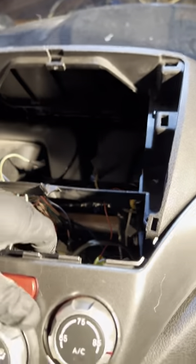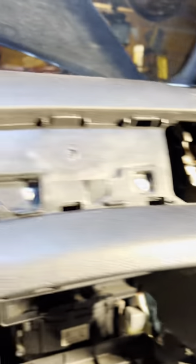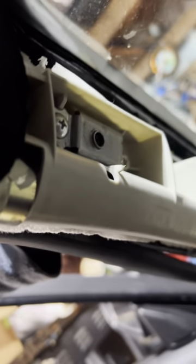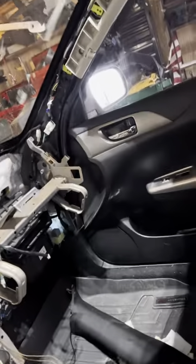When you remove the glove box, you're going to pop off all of this and there are going to be screws that go all the way along here, as well as two behind the cluster. There's one down here and one here as well to pop off the lower panel, and then unplug everything. I'm re-recording the step to take the A-pillars off — you have to remove the little SRS tabs and they uncover a 10mm bolt that holds the top of it on, and it just pulls right out of the dash. Do that for both sides.